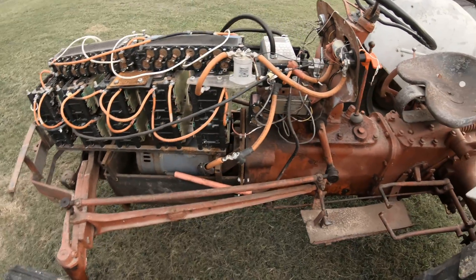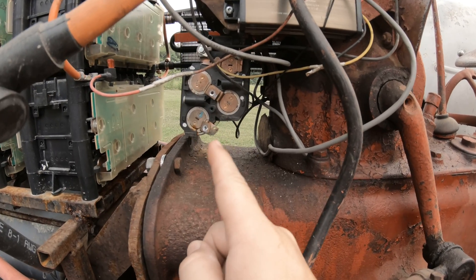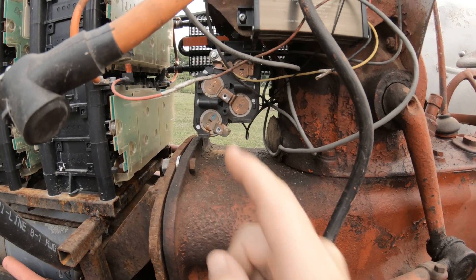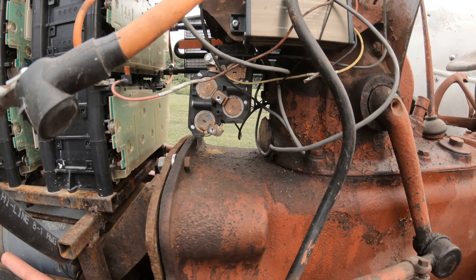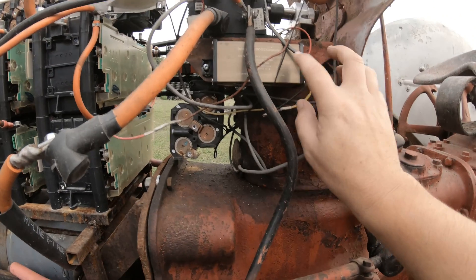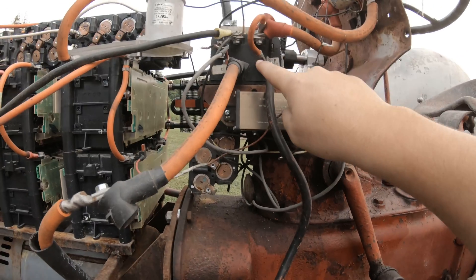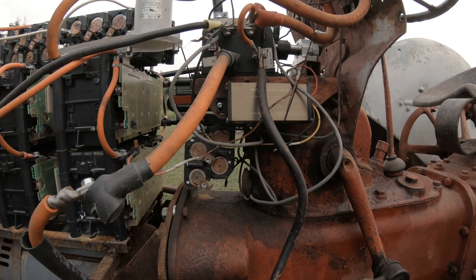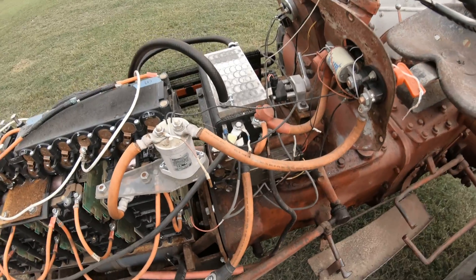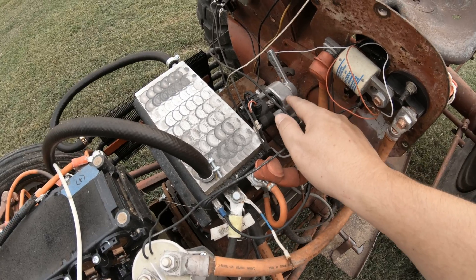Corrosion is certainly starting to show its ugly head and that's just going to continue to lead to inconsistencies between cells. Another thing I would do differently: I hacked one of these lithium cells instead of going to a real lead-acid 12V battery, and that's a change I'm going to make. I'll be going to an actual lead 12V battery — I think it'll be a better fit for the little DC-to-DC converter, which is basically what the motor controller gets its current from. It won't run if it's not there.